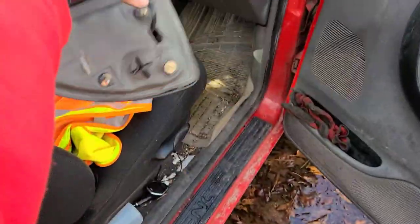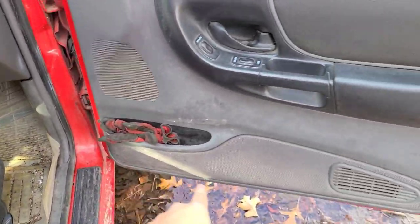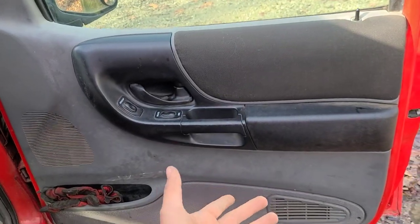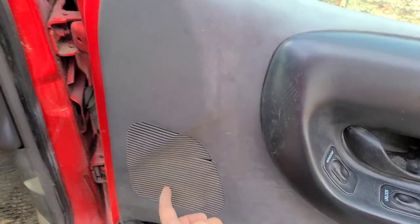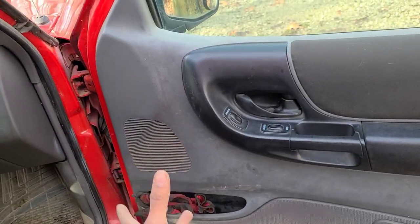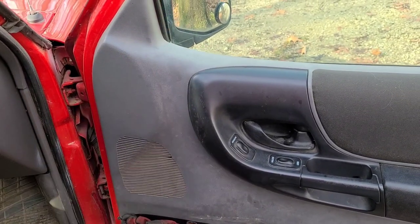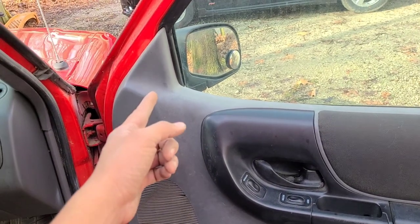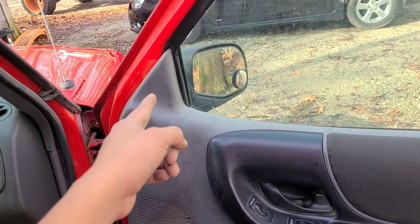Ready? So, gonna go ahead, take the door panel off. It's got a screw down there, two screws in there. Got some clips you pop off here. This'll come out, that'll come out. And then you're gonna take out the speaker so you can get to the plug that goes to the mirror. And then I'm gonna pre-drill two holes so I can fit them into the mirrors.